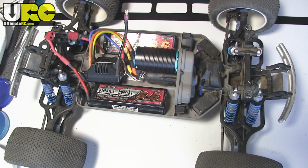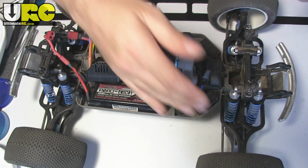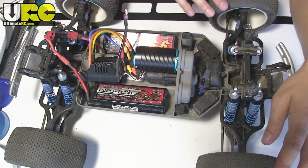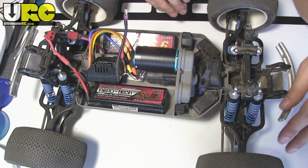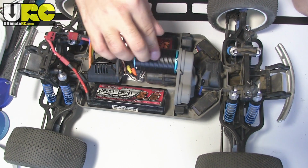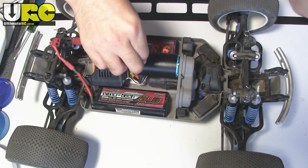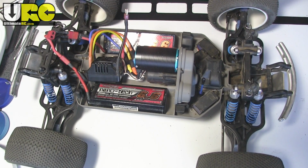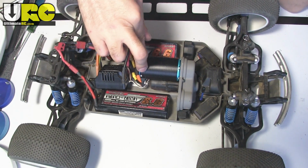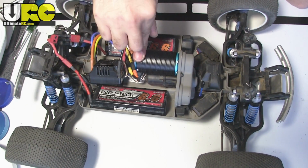I put something under the tires because the track width of a vehicle changes as it goes through the suspension range of motion. So your tires actually become springs at that point as they are pulled inward and pushed outward, and they will actually limit your range of motion. They will change your suspension action artificially. So you need to have a little bit of ability for your tires to skid across the ground a little bit in order to actually see what your suspension action will be like when the vehicle is traveling.